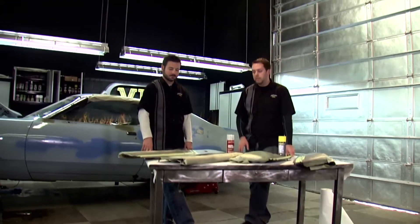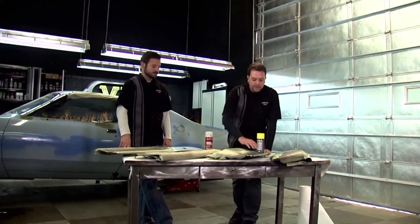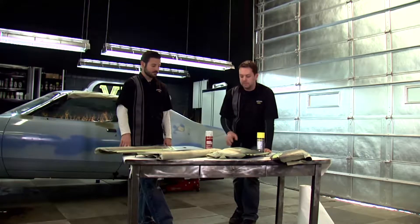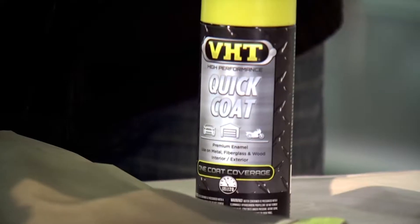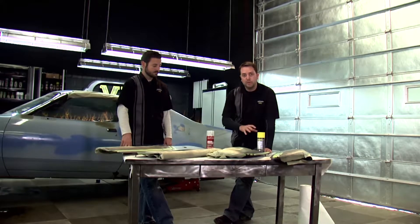We've applied our charcoal and our black vinyl paint. What we're working on next is our accent area. This area here has been scuffed very well, but it's plastic, so just to make sure we have good adhesion we're going to use an adhesion promoter first before we put down our quick coat. The quick coat we will be using is an acrylic enamel that'll match the outside of the car once we have it painted. It's great for wood, metal, and fiberglass, and it's available in a variety of colors.